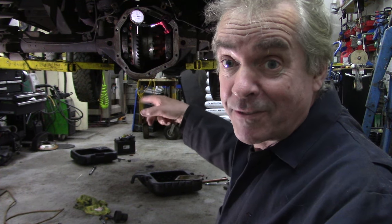There was a clunking inside the differential, inside the spider gears, and I fixed that. But the standard shims made it too tight, so by playing around with some other shims I managed to get that right. I'll show you my setup in the vice in a minute. But when I put it back on — wait, before I did that, that's why the video didn't come out.